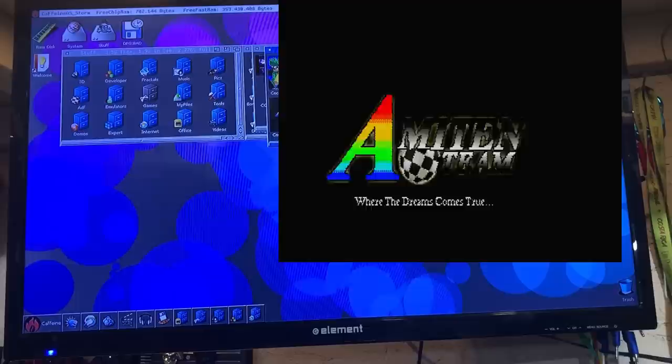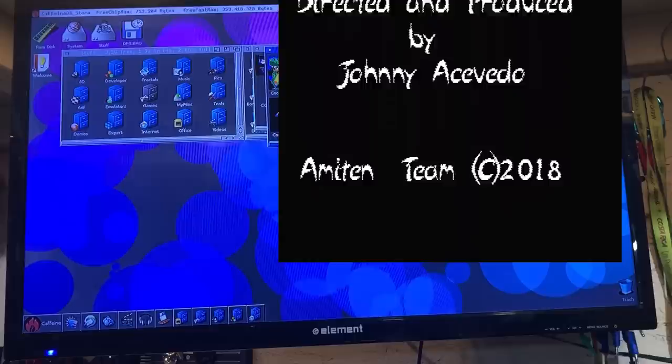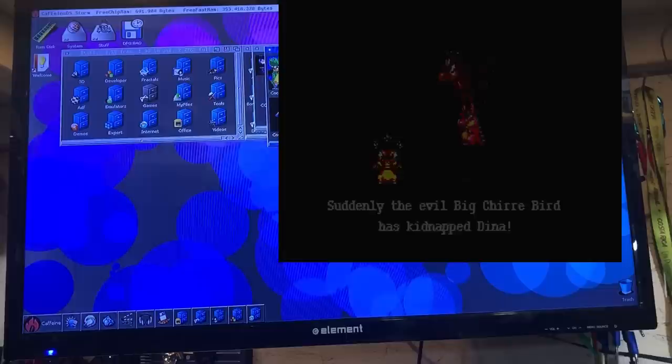Okay, so we've got some flickering going on the TV and it's loading in black and white. And then the RGB to HDMI is coming up. So the quality does not actually look awesome on that. And I don't really know if that's the Pi Storm or not, but you'll see there's some flickering going on. And to be honest, I'm real early into this project to know if that's coming from the Pi Storm, if there's a problem with the RGB to HDMI, if there's a problem with the computer itself, maybe the raw RGB outputs on the thing. But it's not perfect, and I want it to be perfect.